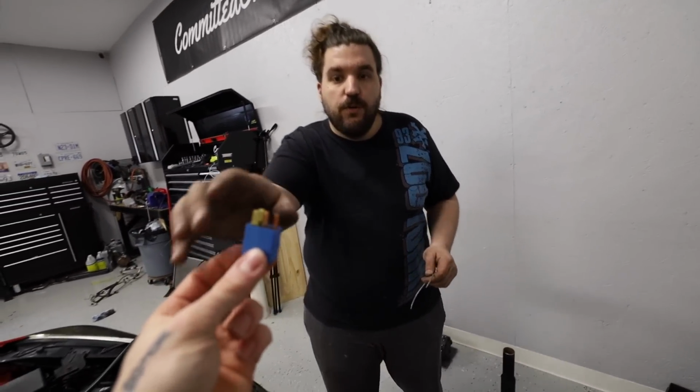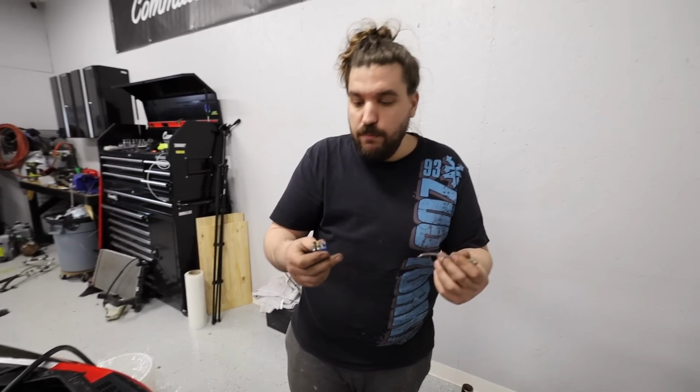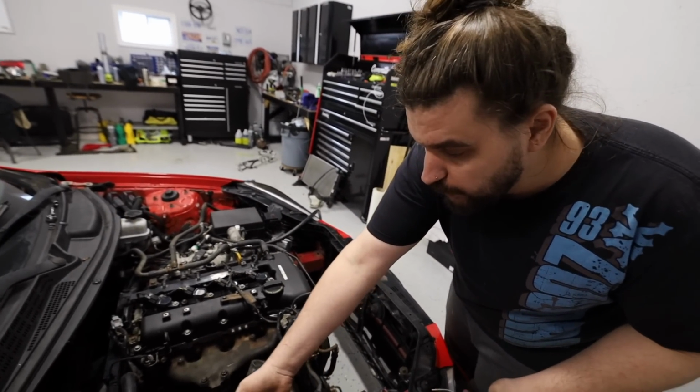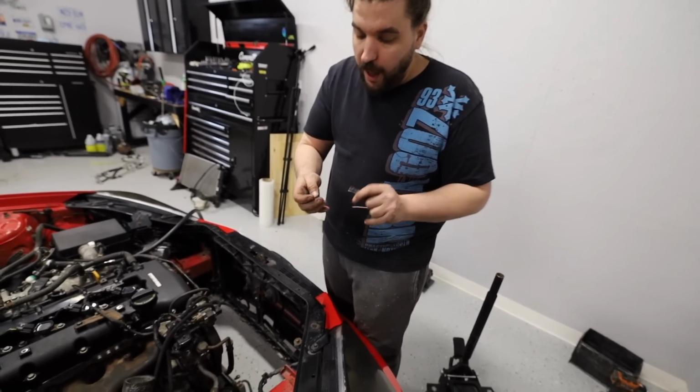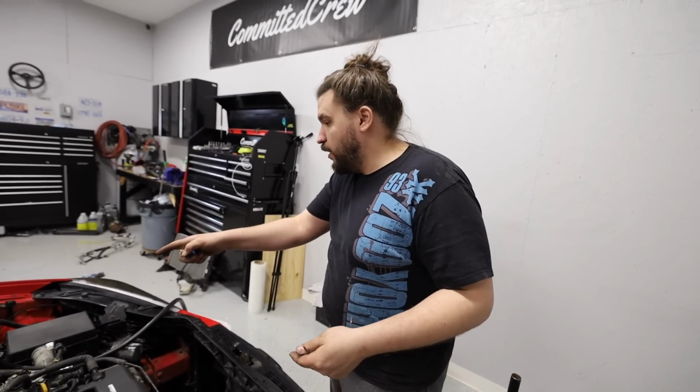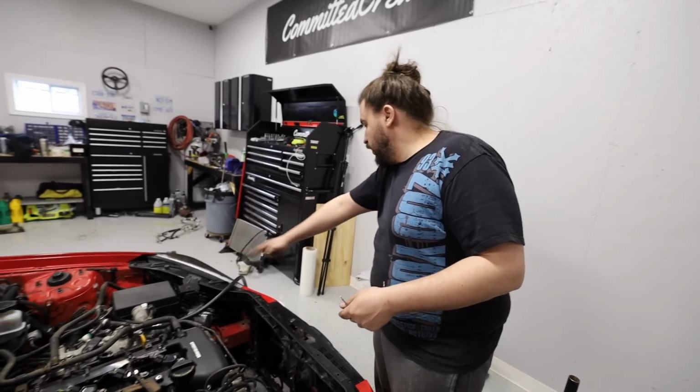Mac pulled the fuel pump relay. And you want to tell them where we're at with this? Because I really don't know. Yeah, so what we're gonna do is we're just gonna jump the wire essentially into the fuel relay spot in the fuse box. I believe it's the 2 copper ones, which will automatically keep the pump going all the time. Okay. And that should pump the fuel from the regulator into the bucket. You want to give it a shot? Yeah. Stink up the garage?